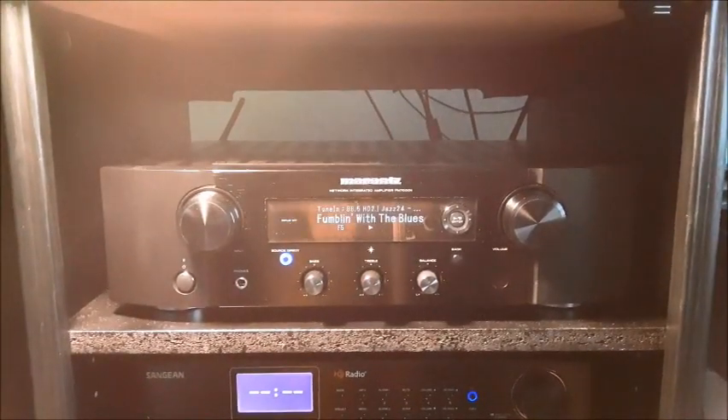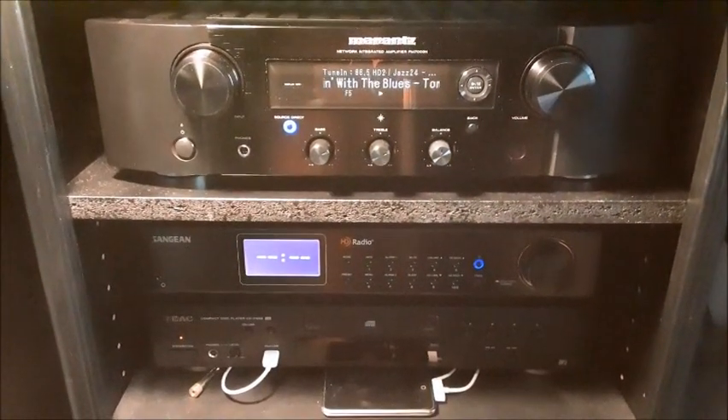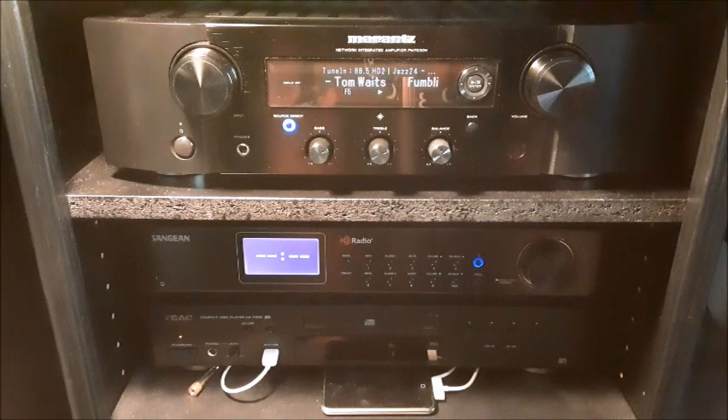The sound is very neutral — I would say very neutral — with just a touch of warmness in normal mode. Dynamics are very good. It sounds relaxing, or 'polite' as many people say. It has a bass knob set at 50Hz giving you plus or minus 10 — each notch is about 2dB — and a treble centered at 15kHz, which is a tad higher than most, probably for those who want to hear high-frequency sparkle.